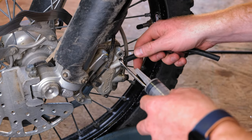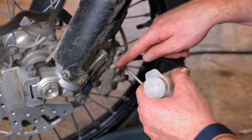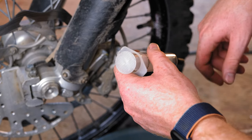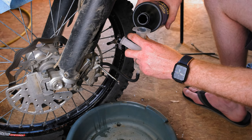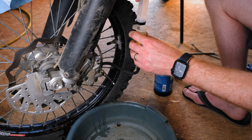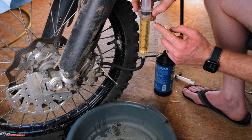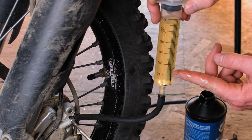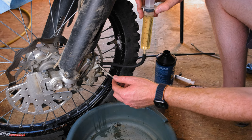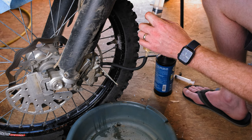Get that loose a little bit, then put this rubber hose on the bleed nipple and on the syringe. What you're going to do is force fluid all the way through the system — through the brake caliper, up through the line, and into the reservoir — until you've pushed all the bubbles out and get good brake feel at the lever. Fill the syringe up with brake fluid and leave the reservoir open. One thing to watch out for: you'll see there's an air bubble at the top of the syringe, so make sure you're not forcing air into the line. Push the fluid down to about here, then refill with fluid again. You'll see it's dripping out a bit — open that a little, it's just seeping around the threads. Now I'm just going to go ahead and put some pressure on it.